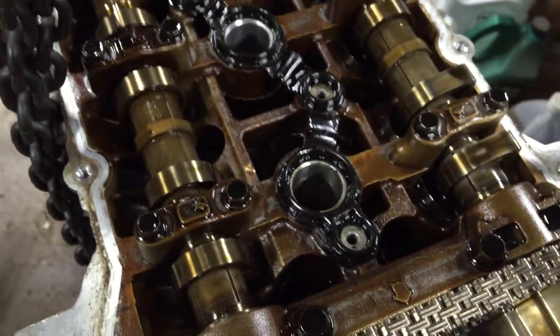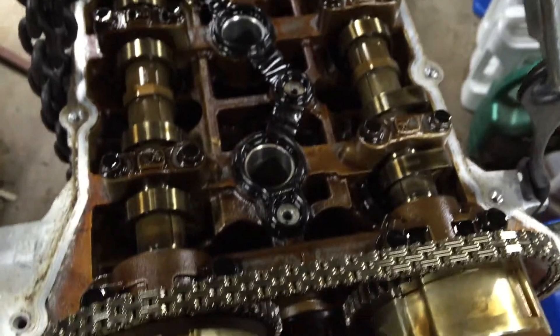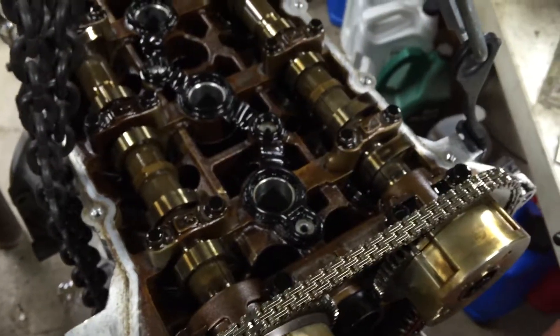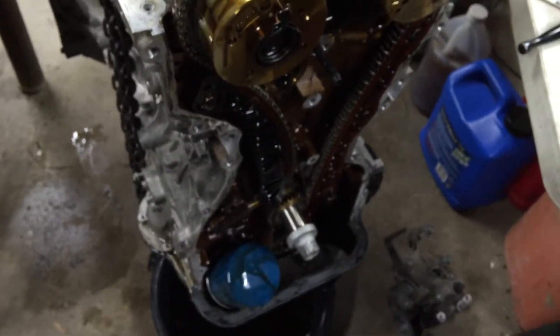That's the stuff I witnessed in the engine oil when I pulled the dipstick — this was when the car was attempted to be started after it ran out of oil. Once I saw that, I told the customer it needed to be towed. It's not going to start again — it didn't have enough compression, and I don't think there was enough oil for the oil switch to allow the engine to start.